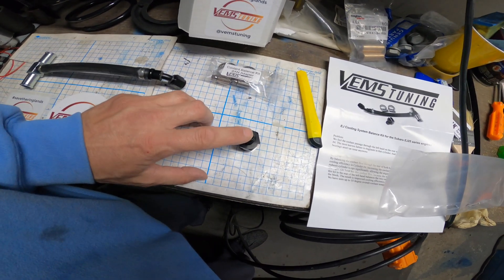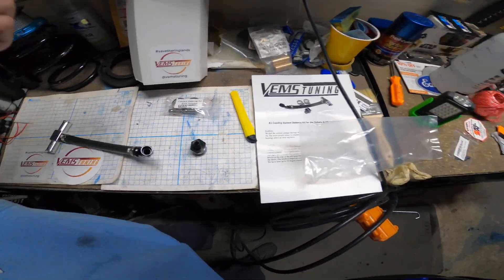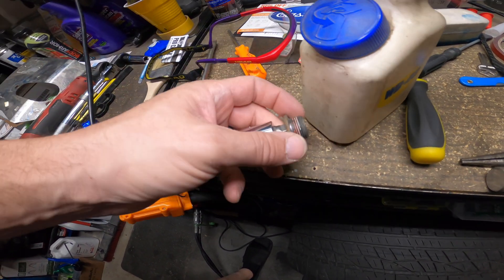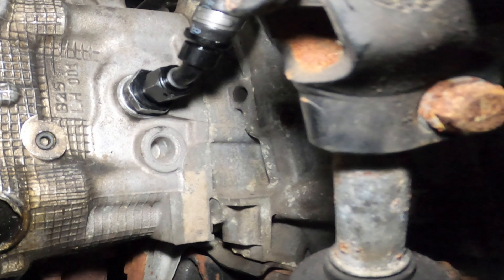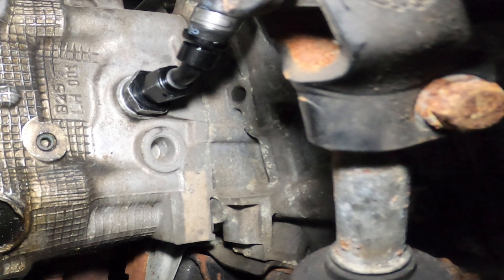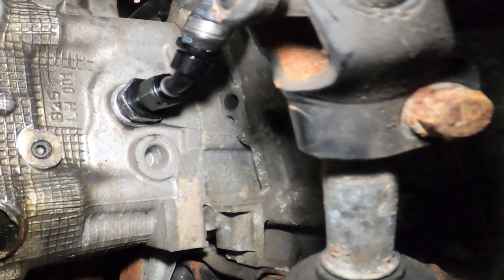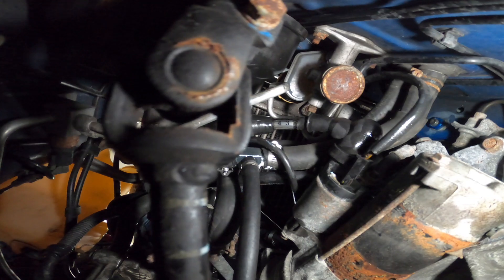Both companies say they've rigorously tested their kits with R&D, so I don't think there's any issue with it. You're going to need a 12-millimeter hex for the bolt that was blocking the coolant passage. I drained all the coolant from the radiator, and when I took the 12-millimeter plug out there was very little coolant. It's a 26-millimeter fitting — it impressed me how well it threads into the actual head. The AN fitting screws in so well it may not even need the crush washer, but it's there just in case.